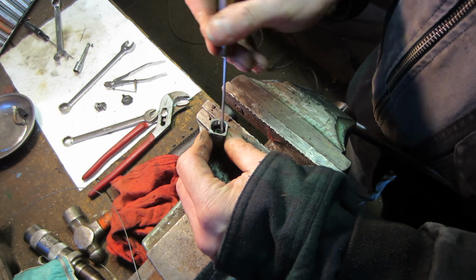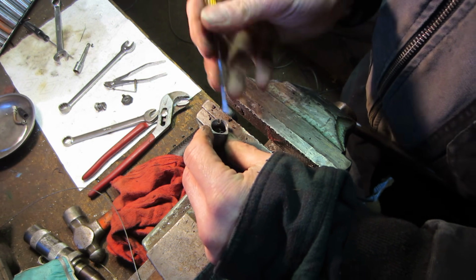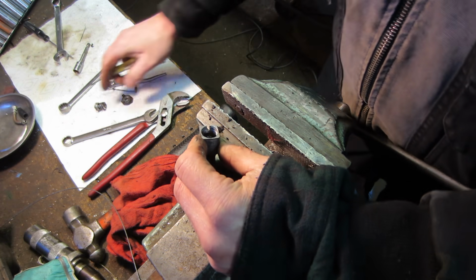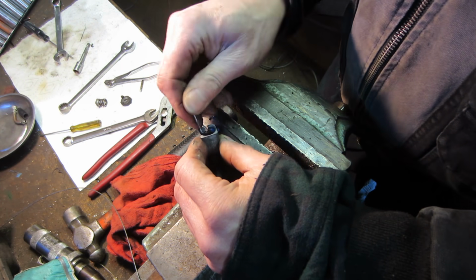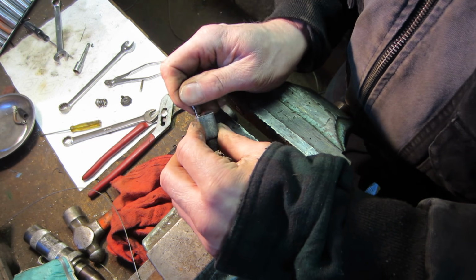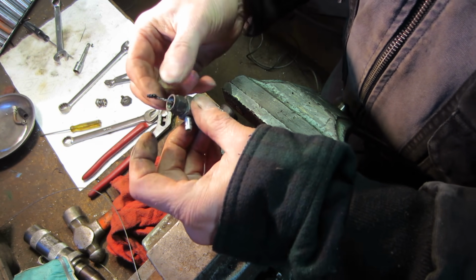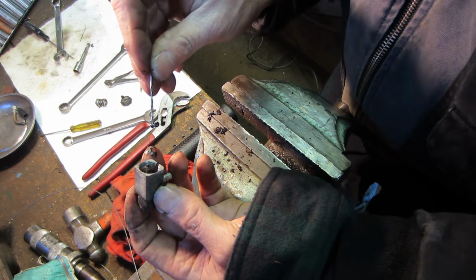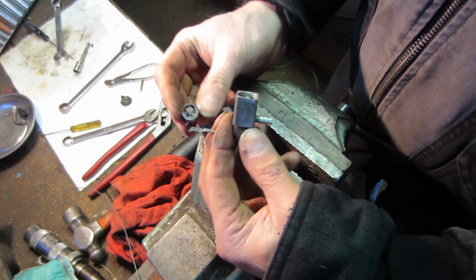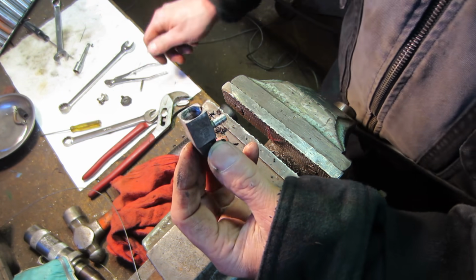I think right where those, see where those two little tits are there? I think there's springs inside there, and the fuel is supposed to travel through those passages. Jam the drill bit in there, pull them out. Nothing but straight caca. That one went all the way through. So that's supposed to go through that half moon that we just saw. Supposed to travel through that half moon, then exit back out of that one with a gasket in there. But that gasket, as we well know, already went to crap.